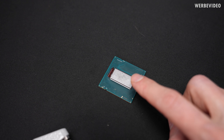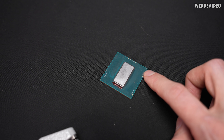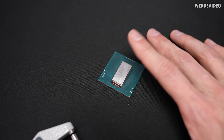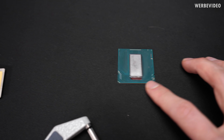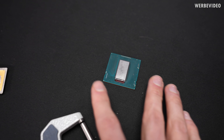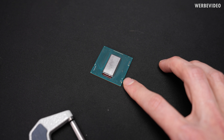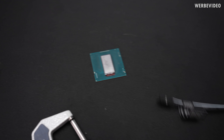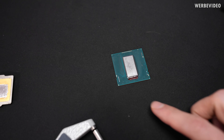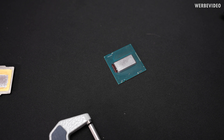That's a good thing because we know the chip in the center has about 0.6 mm height — we measured that in a previous video. That means if we put the CPU cooler on top, it won't directly touch those parts. But we're still trying to cover them because the PCB will bend by a certain degree — not much, but there's always a risk those parts could touch the cooler from underneath, causing short circuits. We have enough space on top to cover those parts and prevent that.